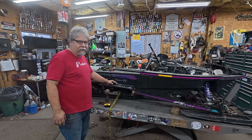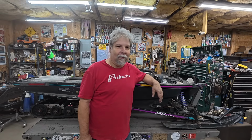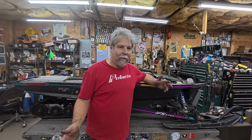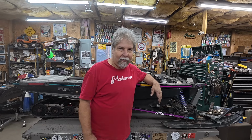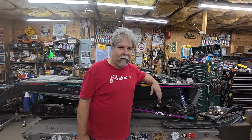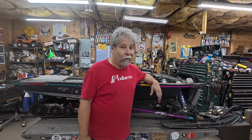There we go, Xtra 12 installed. 2 ratchet straps, some 2x4s, a pry bar, a little bit of patience. No big deal. Well, there we go. We got Patti's Xtra 12 in. Wasn't too much of a struggle. I just kind of made it up as I went. I used a little common sense and jammed that 2x4 under the front arm to keep it up, and took the torsion springs off and ratcheted everything down to make it easy. Maybe there's some way that goes a little faster, but I'd rather take a little longer and put less effort into it. And I feel like it really wasn't that much effort. So there we go. However, rebuilding the skid, that was a lot of effort.